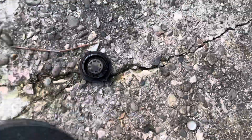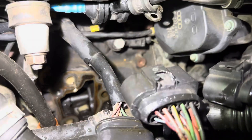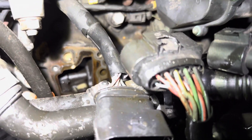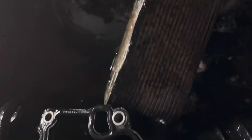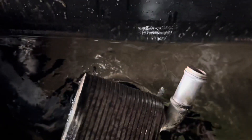But then, as soon as we went to top off the coolant, there was milky stuff in it — oil and coolant were mixing inside the car, which is a huge problem because the coolant would start eating up the bearings and could hydrolock the motor. As you can tell, all that milky substance is coming from the oil cooler housing — this is the old oil cooler housing right here, and that one had milk coming out of it because the oil cooler failed.